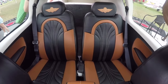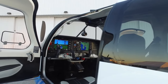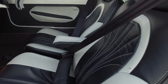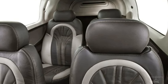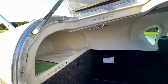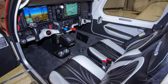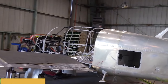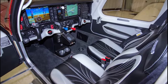In the cabin, the addition of a door on the pilot side comes as a welcome change to Mooney enthusiasts. Getting in without having to squeeze through to the left seat from the right side is fantastic. Both doors are a full four inches wider than the original single door, making for an easy ingress and egress to the front seats. Both composite doors have new latching mechanisms with a robust rod to open and close the door with a thunk. Mooney engineered the door by shuffling around the welded 4130 tubing used for the forward fuselage cage.